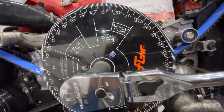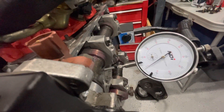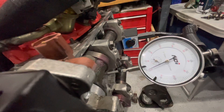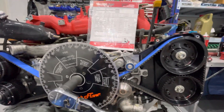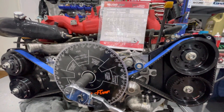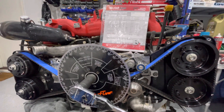Bit hard to show on the camera. And what should happen if I keep on turning — I'll make one more revolution and then stop. That's it. That's how I know it's one millimeter before the valve is totally closed. So confirming this cam is now dialed in. Repeat for the other three remaining. Obviously you've got a different spec for the two exhaust wheels. That's about it.